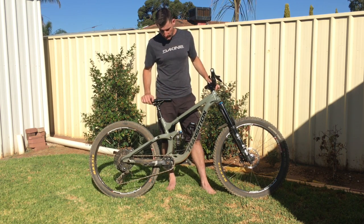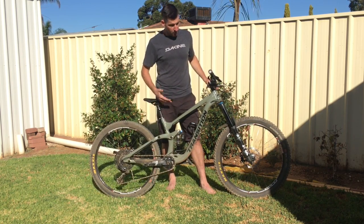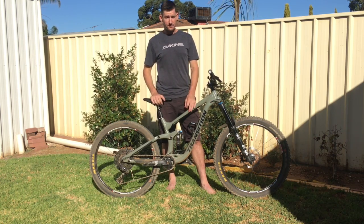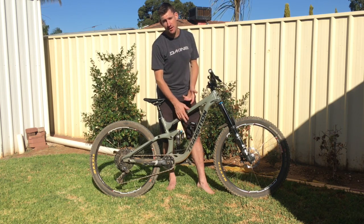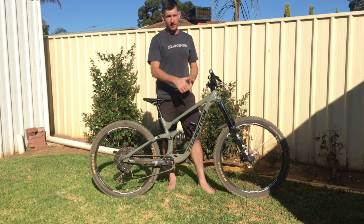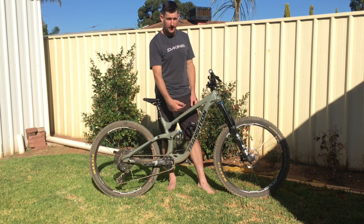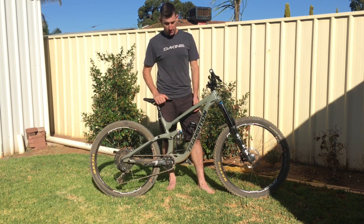Outside of that, it's absolutely killer. Rear shock's much better with no spacers. So if you're riding one of these bikes, try it with no spacers. Go as stiff as you can go without losing your compliance or losing your geometry. And obviously, rebound to taste. And if you've got the compression adjustment, wind it all the way open. I did play around with going back and forth with the compression, but any click I did just made it a little more choppy. Another click, a little more choppy again. And I had to come away from that. So zero clicks - it's completely open, all the way open. And it's just excellent.